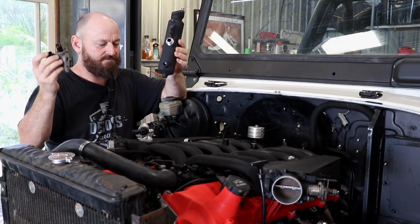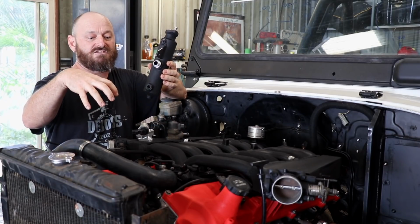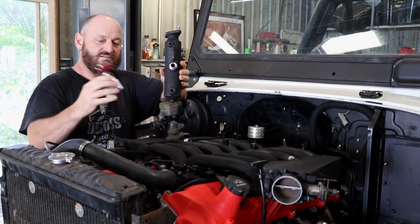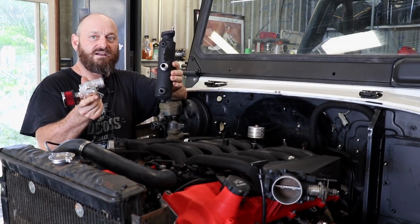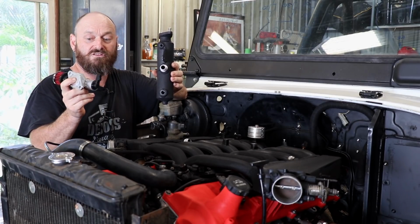So there's a lot of buggerising around with extra relays and turning things on and off afterwards. The ECU remains on after you turn the ignition off for it to reset that. So we're replacing that with this Siltec valve, which is just a single wire output. Saves you tons of wiring outputs that you can use for other important things.